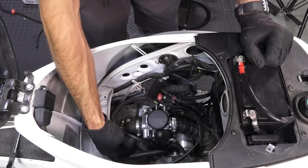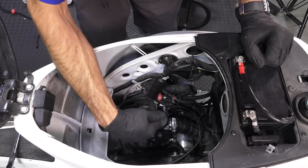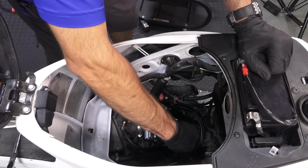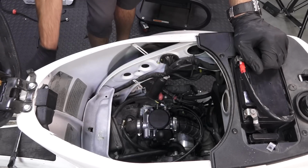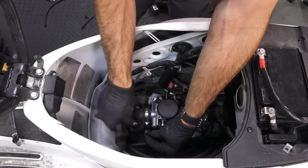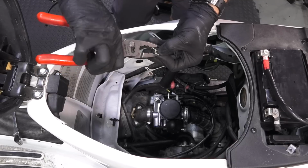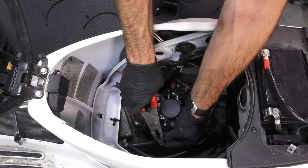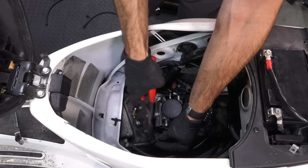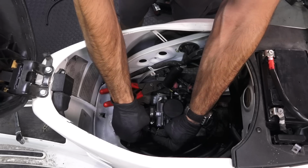And we're also going to need to tap into this line for the vacuum petcock signal for the replacement fuel valve that we used to replace that electric fuel pump. Go ahead and use this vacuum tee to tap into this vacuum line that also goes to your air injection. The air injection there opens up a valve to add extra air to the exhaust stream so the engine runs a little cleaner.